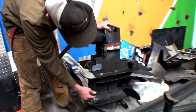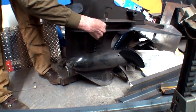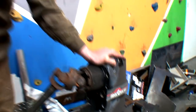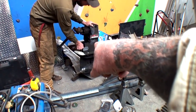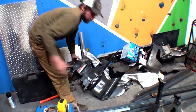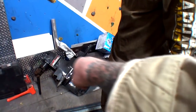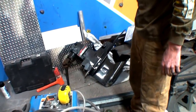The water gets pumped into these holes right here. There's a water pump - a little impeller inside here - the water comes in through these little ports and goes into the engine, then comes out the exhaust manifolds. You rebuilt one of those for us - it had a little impeller pump that sucks the water in. You should check that every year - I replace them every year. You pull the lower section out with four bolts and the shifter.